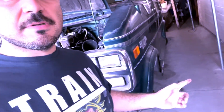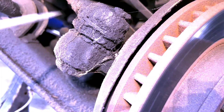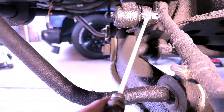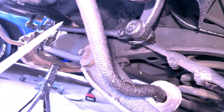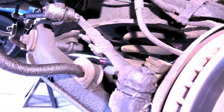Now that the van is raised up and the wheels are off, it's time to really check it out and see what it's missing. First and most notably: the tie rod end is gone. This arm is gone. Pretty much from a quick look, the whole thing — from tie rod to all these arms connecting to the van — they're pretty much toast. You definitely need to replace all of that, because it does have driving and steering issues.